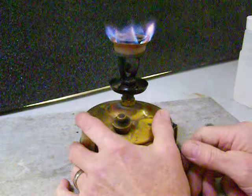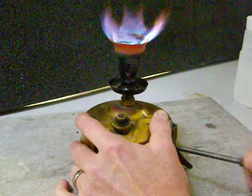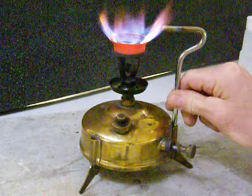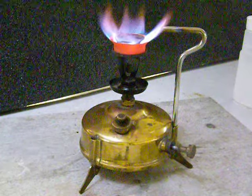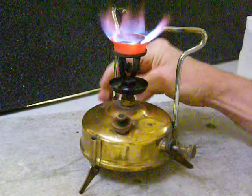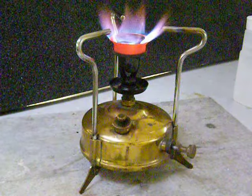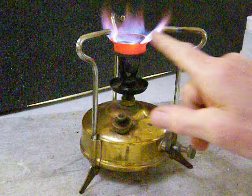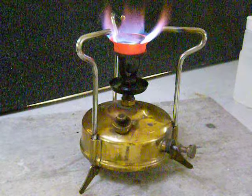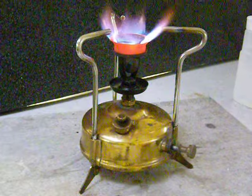We want to make it operate with a little more vigor — we can add a few more pumps. Put some pot legs on. You can do this beforehand; you don't have to wait until after you've started it — I was just trying to use it for clarity here. And now you're ready to put your pot on and heat things up. You can see that my flame here is a little yellow. My jet on this particular stove is a little worn out, so this is a little yellower than I would like, but it does blue up pretty well when I put the kettle on.